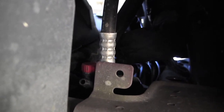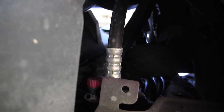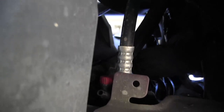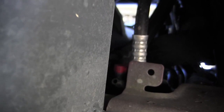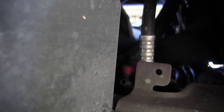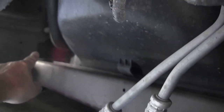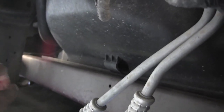There's my petcock right at the bottom of the radiator with a red cap on it. I won't be able to show you that because it'll be really messy and I can't hold the camera. If you didn't have a petcock, you would take the radiator hose free and let it drain out that way. Let me get a bucket and open this up.